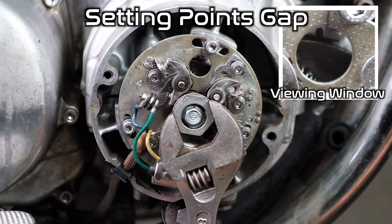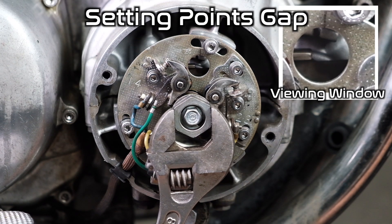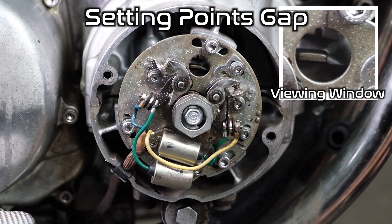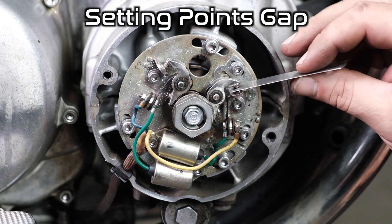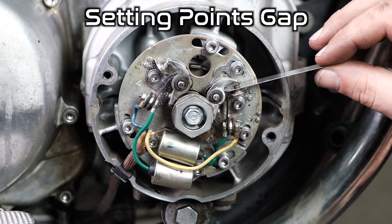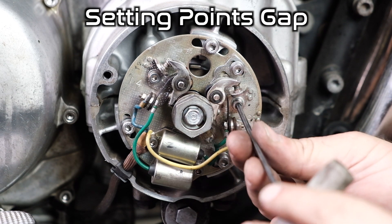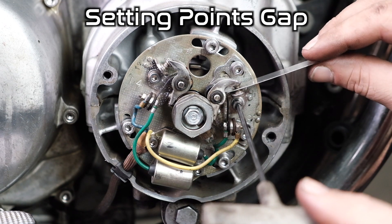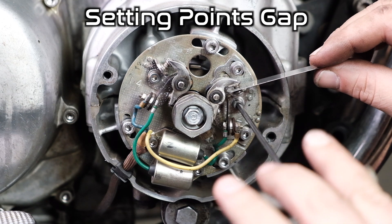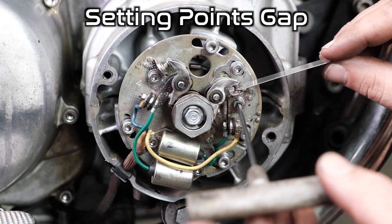Here's my fire mark for the two-three. I'm going to rotate 90 degrees from here to line up the tang — about right there. Same exercise: I'm going to come in here and that is way too loose. Be gentle when you tighten the points mounting bolts because you can cause the point to move and change the gap value, so it's a very gentle tightening. That feels pretty good.